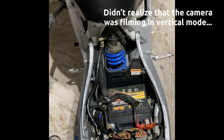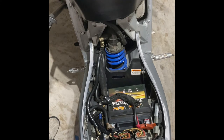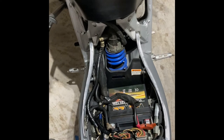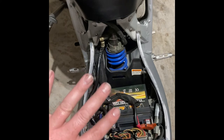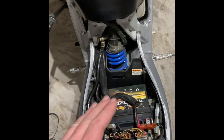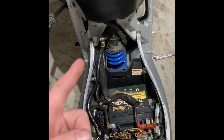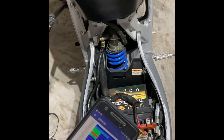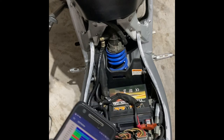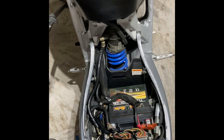All right, guys. Well, we're at the last stretch of the race here. So what I have to do now is set the AFV to 100. It's probably jumped way up since, during testing the pump after installing it, making sure everything worked, the computer's like, holy crap, there's no fuel, go through the roof, right? I don't know, it seems kind of odd to me that that's the situation, but anyways, that's the plan. We gotta make sure AFV is set to 100.